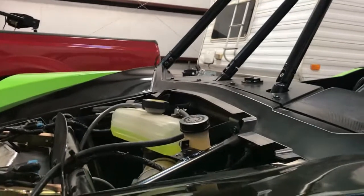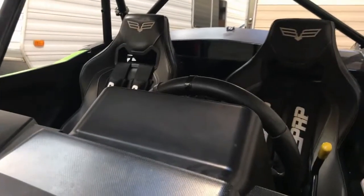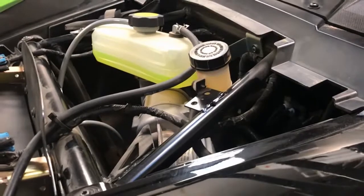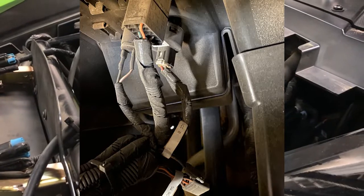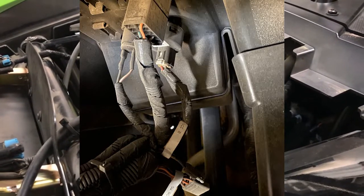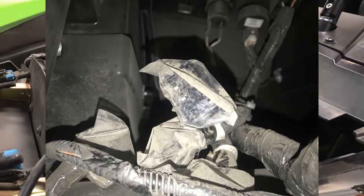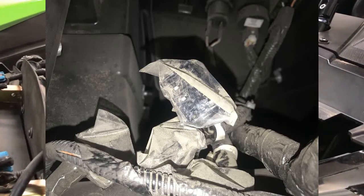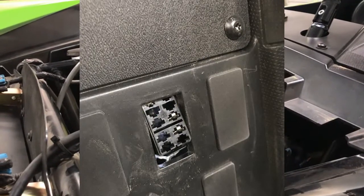The B circuits are a little bit more difficult to explain, but the B circuits are also switched power. Whenever the switch is on, there's a 30 amp fuse in the fuse box with a relay that feeds 3 separate 10-pin Carling style blocks. So if you look down through here, you're going to find all 3 of those blocks wrapped in a bag, each individually wrapped. They will be labeled Accessory B1, Accessory B2, Accessory B3. Each one of those plugs has 3 pins in it. It only uses 3 of the 10. That's 2, which is power, 3, which is switched power, and 7, which is ground.